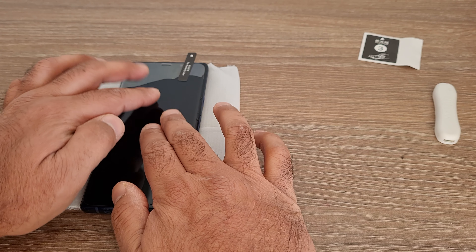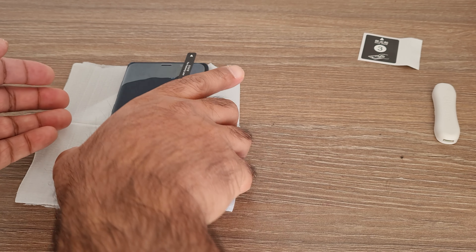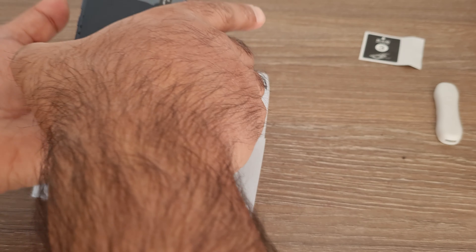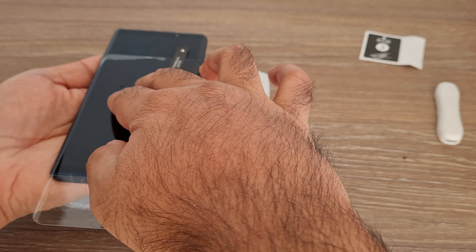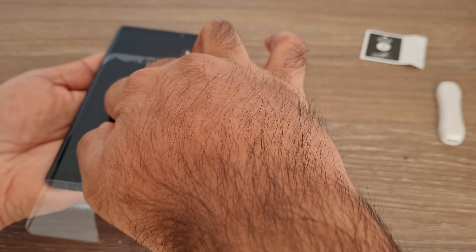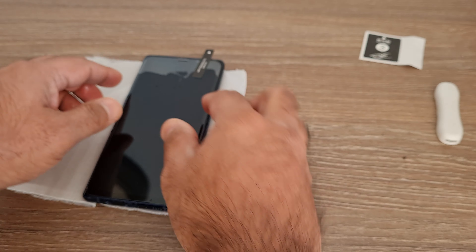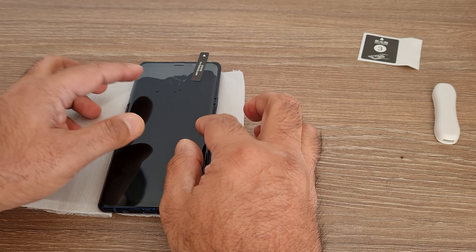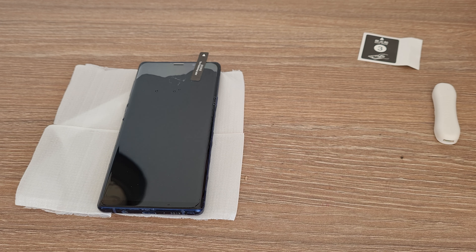It is taking time to spread, so I'm trying to spread the glue by pressing lightly with my fingers and moving the glass protector. At this stage I can still move the glass — after the UV light process, you wouldn't be able to move it. I will give extra time for the glue to spread on its own as well. I also left the upper plastic on by mistake, which you can peel off before or at this step.